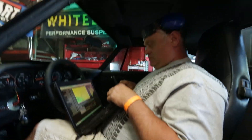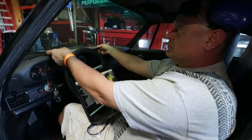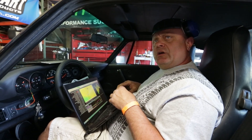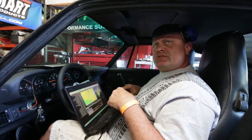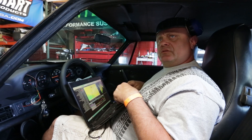417 ain't bad on pump gas. So essentially you're into full boost control tuning now — fuel setup is done, and timing: I've made a couple of changes so far and I'm going to make another adjustment in a different direction to see how it behaves. Otherwise it's looking pretty clean.